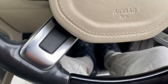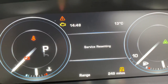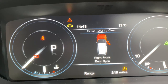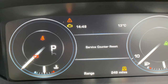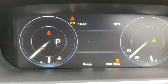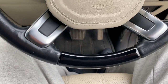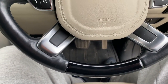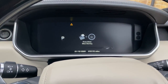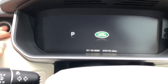Press the brake and accelerator pedal fully and hold. The message will come out saying 'service resetting', and now the service counter is reset. That's all — small procedure. You can release the brake and accelerator pedals, turn the ignition off, and turn the ignition back on.